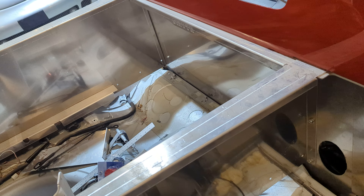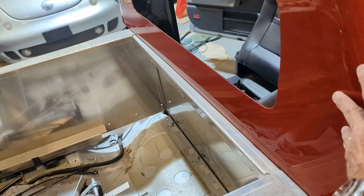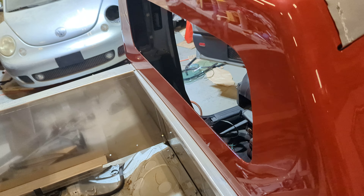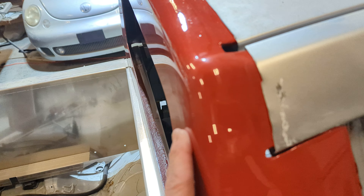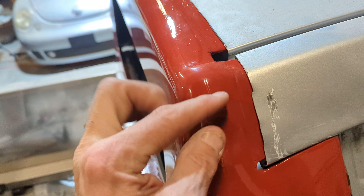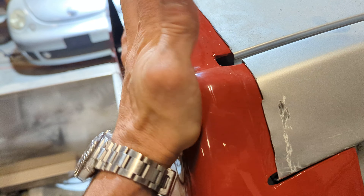Here is how I position the bed and the rear surround. This will be in black gel coat. I always pre-paint stuff before I install it. I slide it in at the right height — this slides into the cut. This is a rough fit. I grind all this down before I use panel bond, and I push it all the way in.